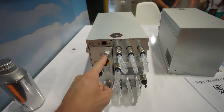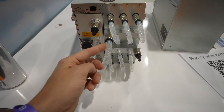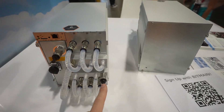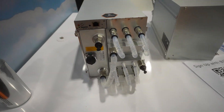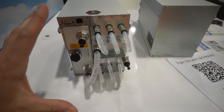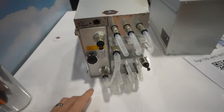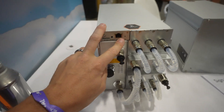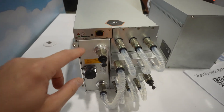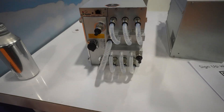You have your cold water coming into the PSU over here — not hot air, cold water. I got used to talking about air miners. The cold water comes in here, gets a little bit heated up, then comes into your three hash boards — one, two, three. It circles in and around, cools them off, comes out hot here, and then continues on to the radiator and fans to be cooled off. Then it re-enters back in here and repeats the cycle — constant pump, constant circulation of water keeping everything cool. You have your ethernet connection there and your SD card.